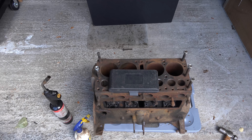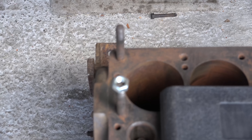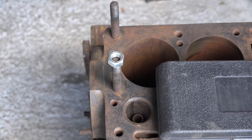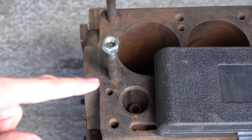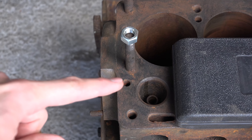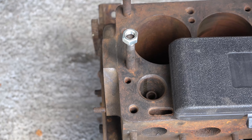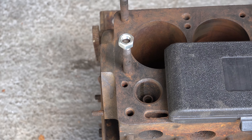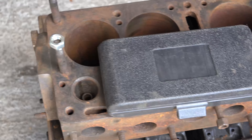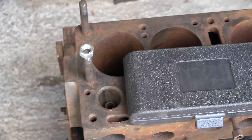What you have to do first is hit the stud with a whole load of heat, because you're trying to break the bond it has inside the block. The heat goes down into the block and makes the stud expand in there - the walls separate from it in the threads inside the block. Then you hit it with a load of WD-40 which causes it to contract and break the rust grip inside the stud, and then you can remove it using the stud removal tool. That's the theory anyway, but of course things don't always go to plan.